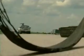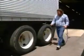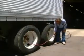Their image as scrap rubber on the highway is changing as people become more educated in the true cause of rubber on the road. Look for the telltale wire which clearly indicates a tire failure rather than a retread problem. Regardless of whether your truck is riding on retreads or new tires, the most important safety factor to consider is air pressure inflation. Tires which are not properly inflated generate heat, and heat destroys tires and makes our highways less safe for all motorists. The truck tire retread industry invites drivers and fleet tire mechanics to join them in an effort to improve highway safety, reduce vehicle and driver downtime due to en route tire failures, and save money by regularly checking and inflating tires to maximize their life and performance.